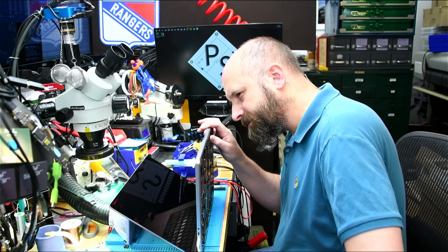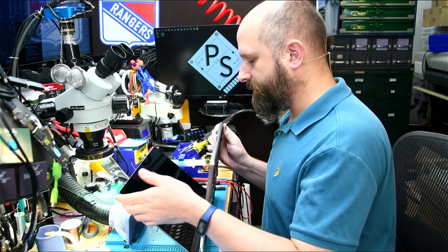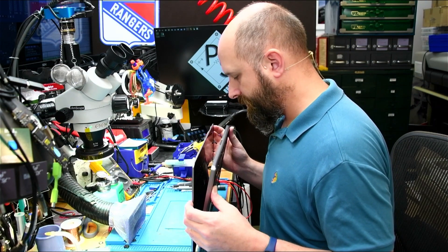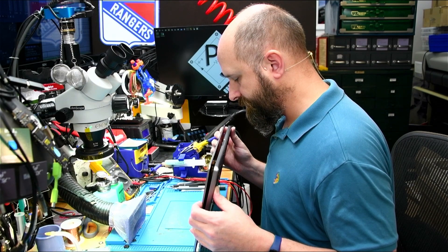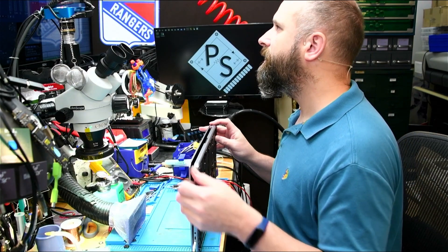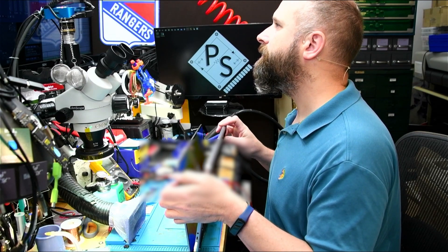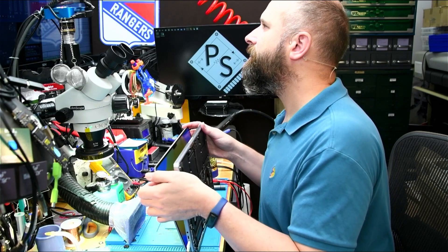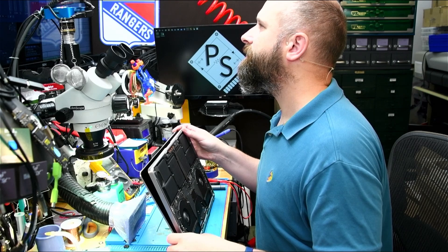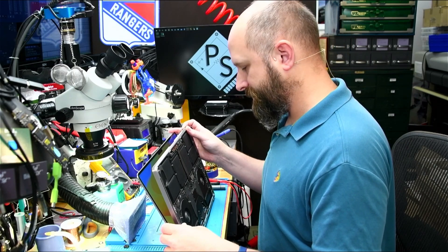I got 5 volts, I got 20 volts, chime — and we have an Apple logo. Now let's see if it sleeps. The fans are screaming because I did not plug in the battery. I'm trying to cover up the person's name. You can see the edge of the screen. Closing, closing, closing — sleep. Open — not sleep. And the fans are going to freak out because I don't have the battery plugged in. So there you go.